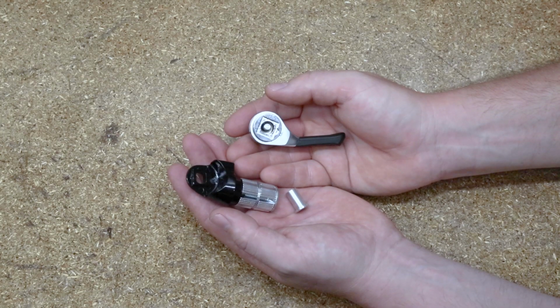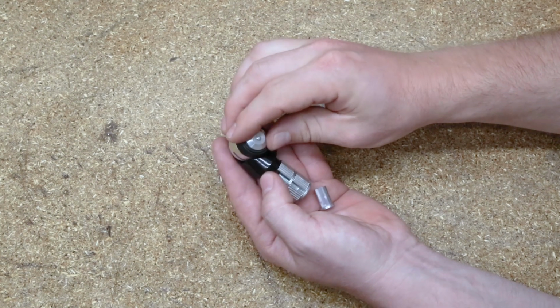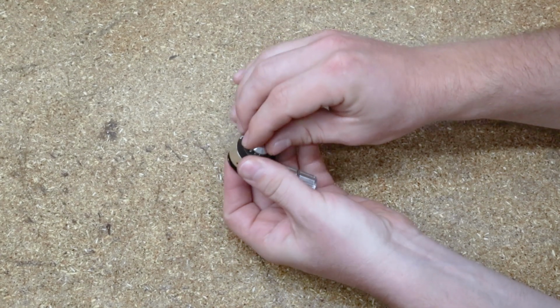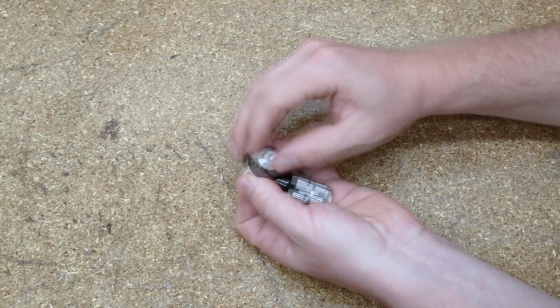To attach the right lever, find the square mounting surface on the plug mount, then match the half circle indent on the lever assembly to the side of the square facing the bottom of the shifter. Push the nut through the bottom of the clamp and the lever assembly, then finger tighten the torque bolt until it's flush with the lever.